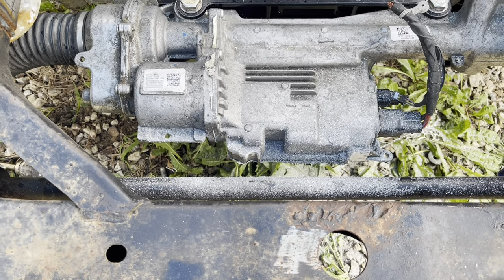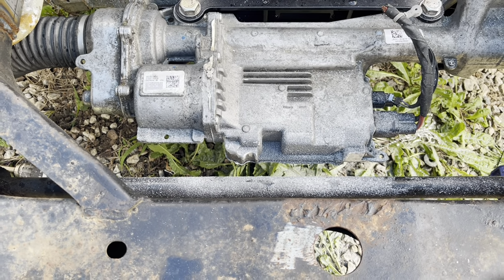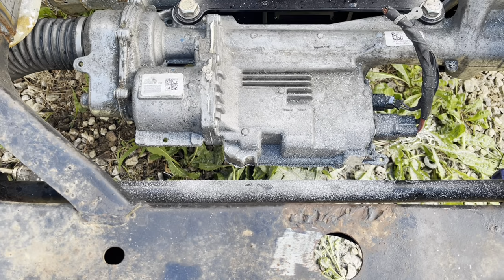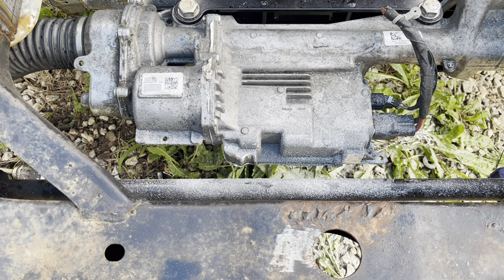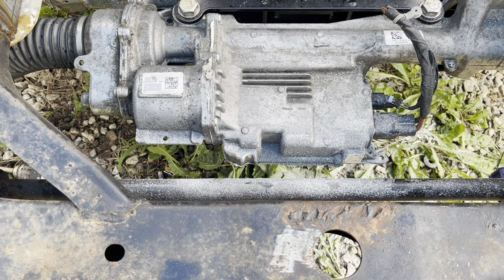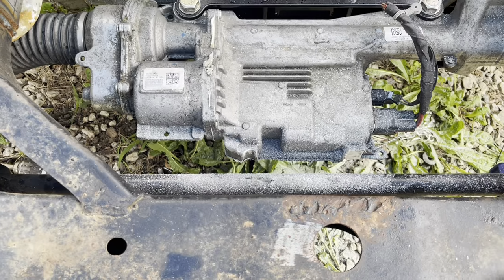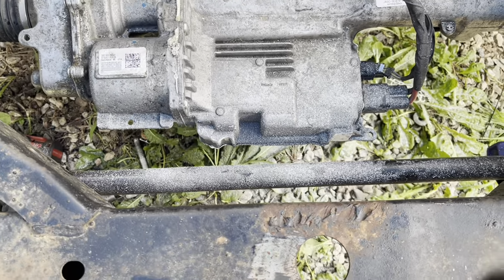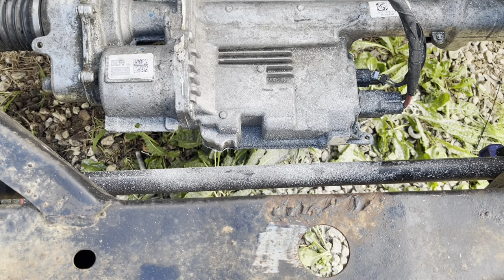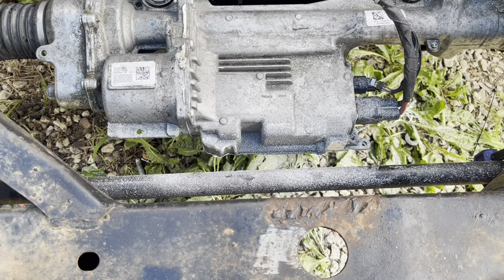During our whole machining stuff, where we've learned on machining parts, it's all about surface speed. So I slowed the surface speed of the tool down, cut it all dry, no more galling. It didn't fill the tool and stay packed. It just cut. It worked out really good. So I think I've got my clearance that I need. We'll set you back up on the tripod and we'll go from there and see about putting this back together now.